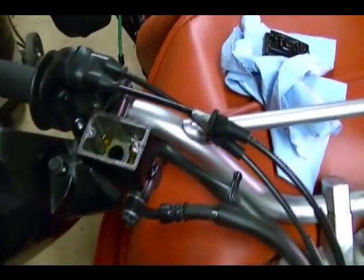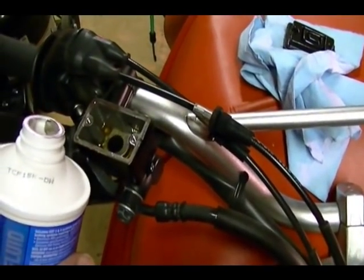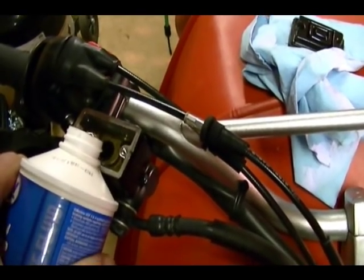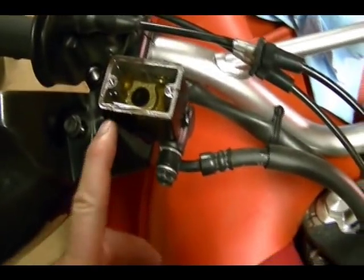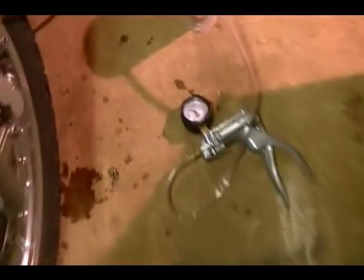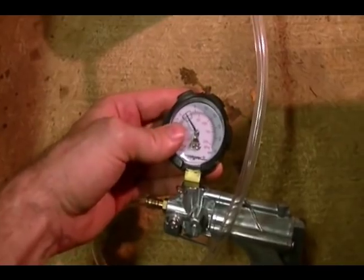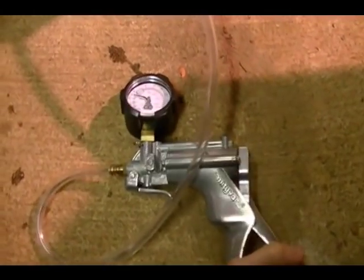The first thing I'm going to do is add brake fluid to the brake fluid reservoir using the recommended DOT3 or DOT4, or whatever your manufacturer recommends for your bike. I'm going to fill that up. After the reservoir is full, I'll come back down and create a vacuum. I'm going to pump until the dial is right around the 10 mark and then open up the bleeder screw.